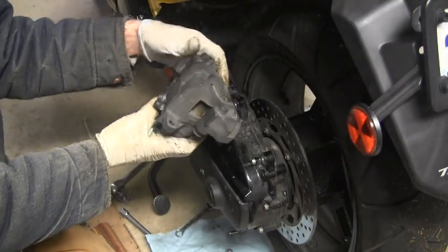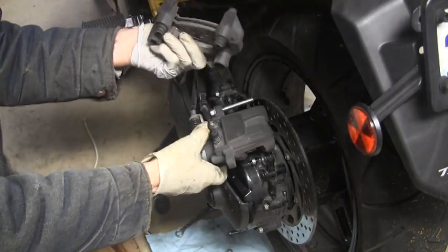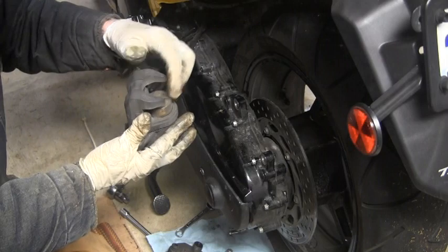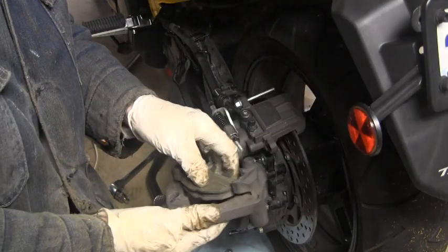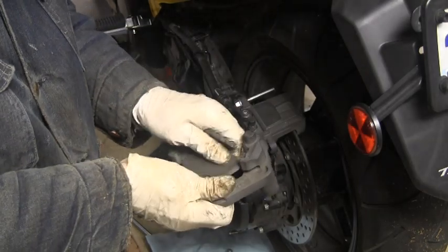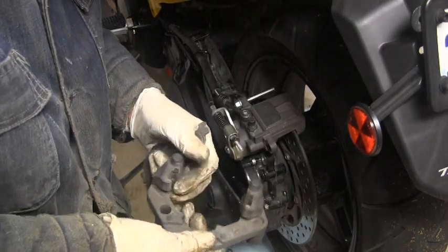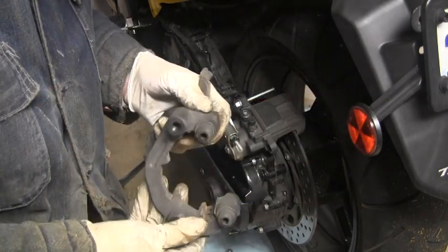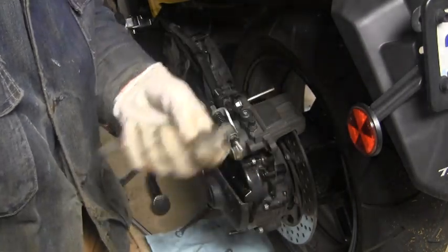I think I have to pull these spring clips on the ends, then they come out. Let me go ahead and do that and do a little cleaning at the same time. Once you pull this pin out, the whole thing slides right off. Now you can pull out the pads — they're right in there. There's something I have to do with the piston to get it to go back in again, so I'll read up on that. Once you have the caliper off, these guys just slide right out. And this one went way too long — it's way too worn on the back brake.